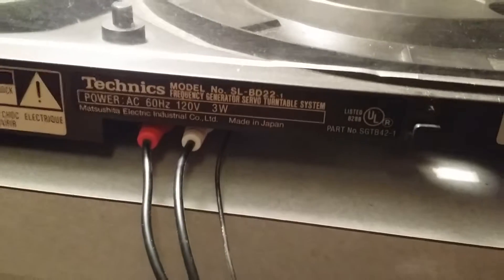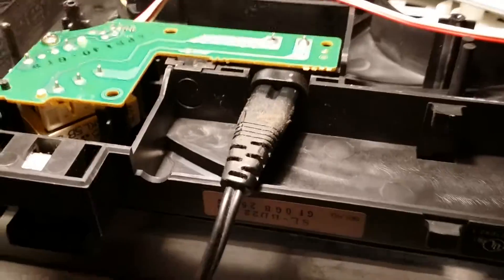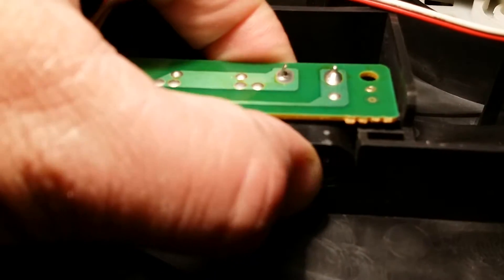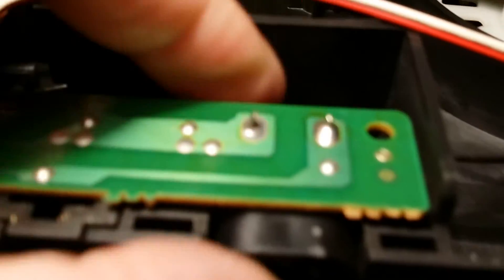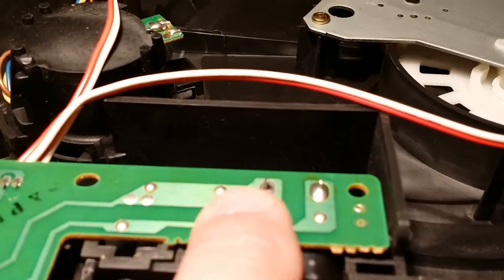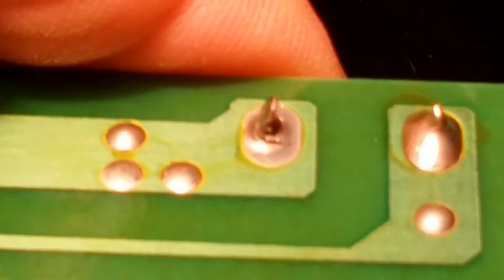So I took it apart and I'm going to show you what's going on. Here's the back — it's upside down. The power cord goes here; I'll take that out so we don't have any power. What's going on is that this has been loosened because the solder points — the connections for the positive and negative — this one here has broken itself loose. You can see right there it's cracked, and as I wiggle it you can see it moving.